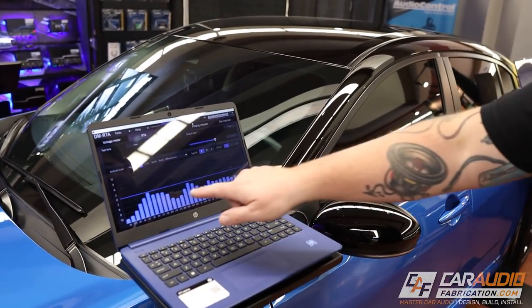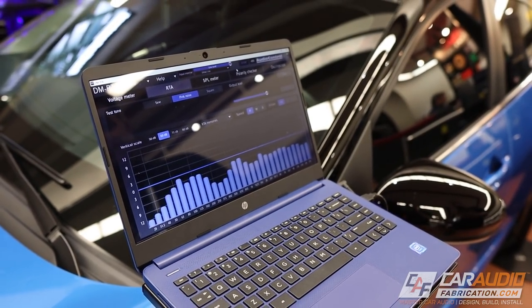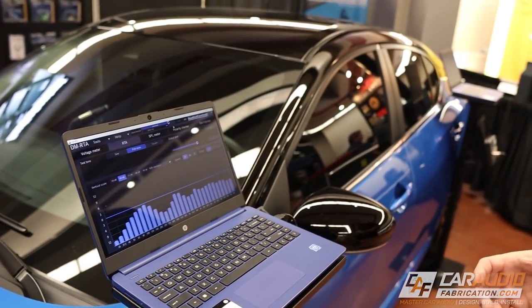So even though we're playing pink noise, which should be basically flat all the way across — the blue line there — you can see that the factory OEM head unit has an EQ curve. They've cut some of the bass, they've got a little null here at about 300 hertz, and they've definitely got a factory EQ applied. That's extremely important to know because it's going to determine what integration solutions you should use. If we're putting in an aftermarket sound system — even something as simple as just a bass package, adding an amp and a subwoofer — we need to know what signal we have to work with. Does that signal even have any bass in it? If we're putting in a DSP, now we also know what we're going to be correcting for.